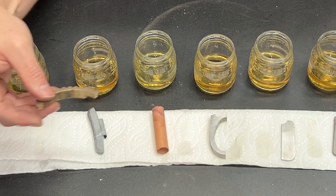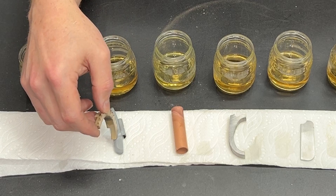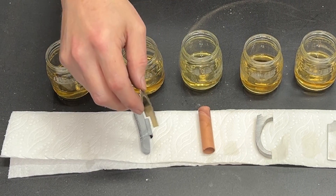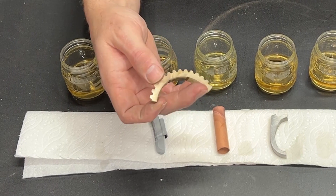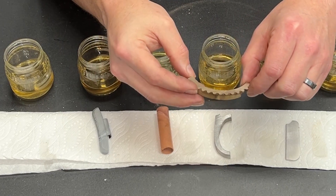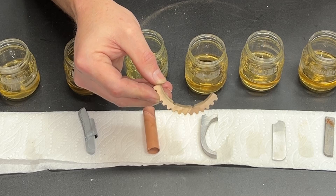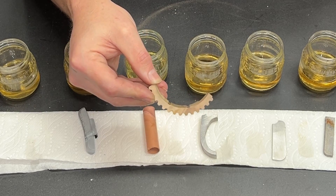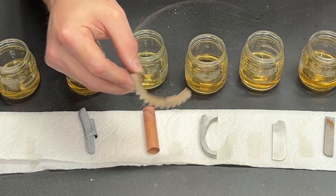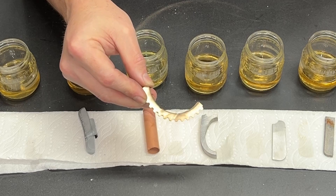Last we have brass. For those who realize, brass is made by mixing zinc and copper, so being that both of these metals were etched by Pine Sol, it's safe to say that brass is probably also going to be etched. And sure enough, the half that was in the Pine Sol shows some etching. Interestingly though, as an alloy it's less etched than the copper and the zinc alone — something is helping to protect it.